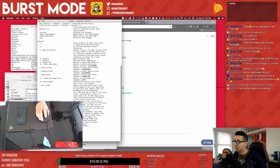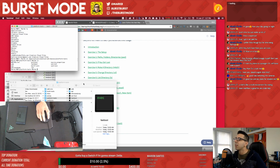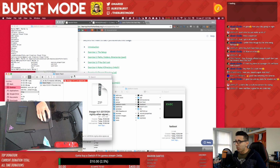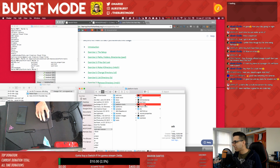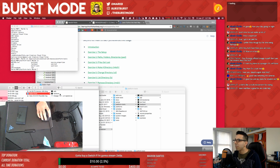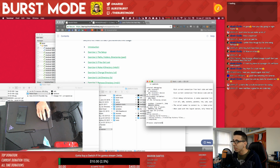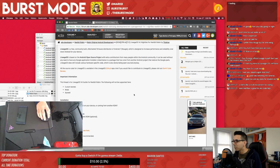That's how you would do this, right? And that's all contained within fastboot. Now, I made a folder on my desktop called Robin Flash, and these two commands here are the two that I'm going to need the most. So I'm going to copy those over here so that we don't have to keep bouncing folders back and forth or referencing an executable that is somewhere else on the computer. I'm going to want to point the terminal window to one folder and then just leave us in that folder for the rest of the time that we're working here, right?